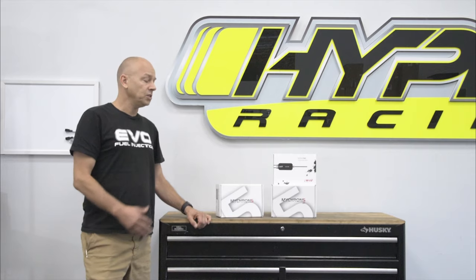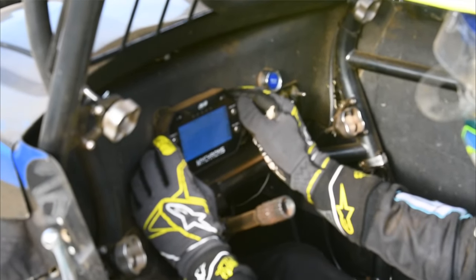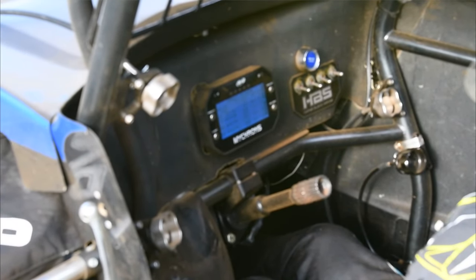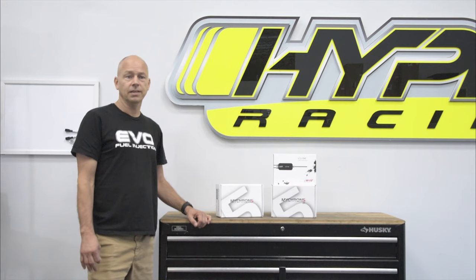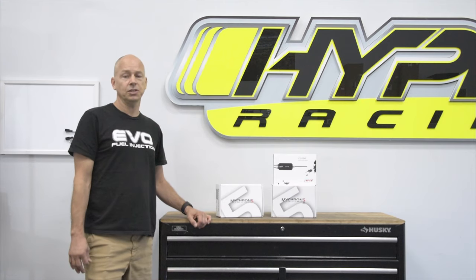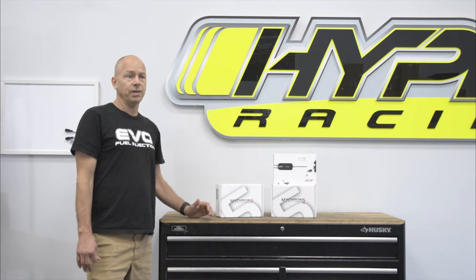The cool thing about this one is it displays your top three lap times. As soon as you come in from warm-ups, you can look at your high and low RPMs really quickly right on the dash, and you can tell if your gearing is dialed in or not. You can see what your lap times are, so you can see if you're competitive, what you need to change. A lot of great information.